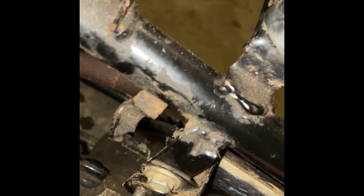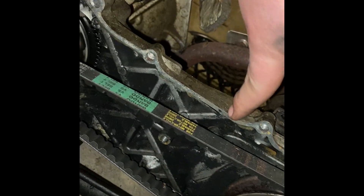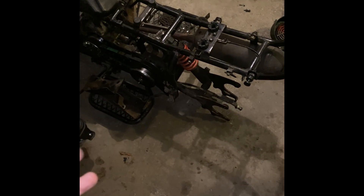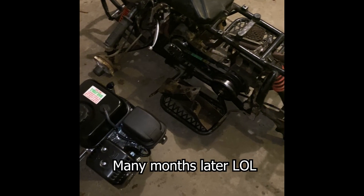Basically, we're cutting the CVT in half. This point here is where the oil is in the transfer case. There's no oil past this point, so we can just cut this out, take the engine part out, slide this in, and have a belt clutch on the front — so we'll have two clutches for a torque converter. We'll have a torque converter slash CVT going directly out to the stock sprocket and the stock wheels. So we won't have to worry about buying a custom rear axle, which would be expensive — like $200, which is pretty much the entire budget for this build.